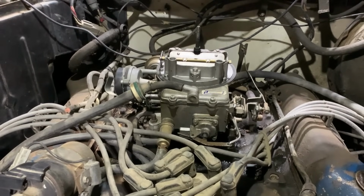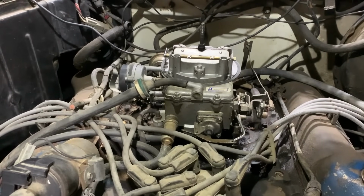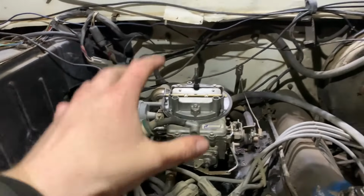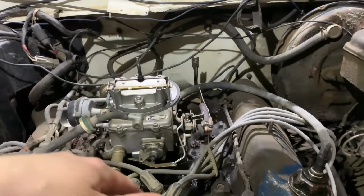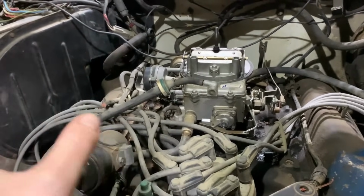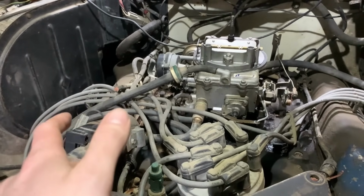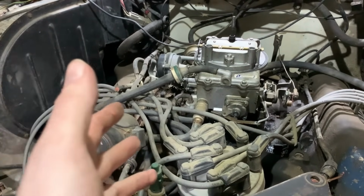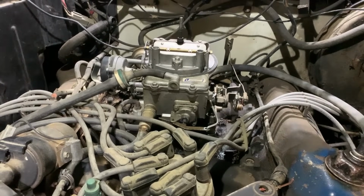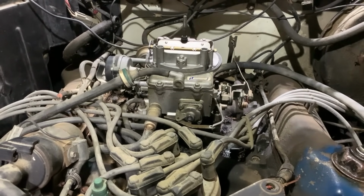And another issue that pertains to vacuum leaks is unfiltered air going into your intake system. So rather than everything just going into your air cleaner, being filtered through the air filter and then down from there, you've got air introduction in all these other places that's not being filtered. So if you're going through a dusty climate or whatever, that's just being sucked into your motor, and you don't want that either. So it's going to be really beneficial to clean things up and make it all work properly, because that's stuff you don't want to have.